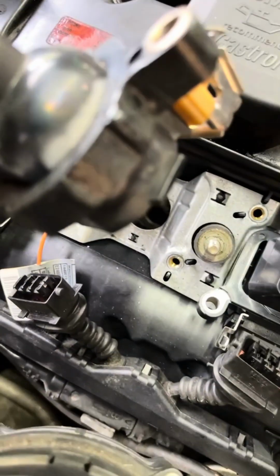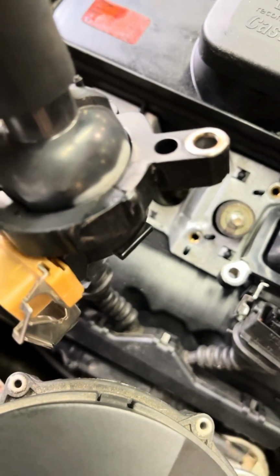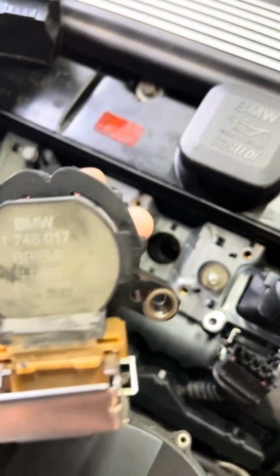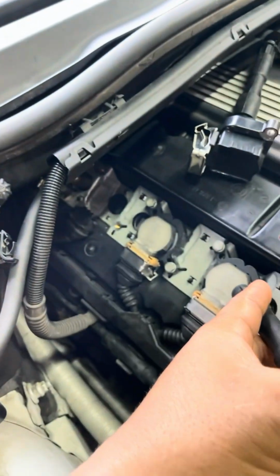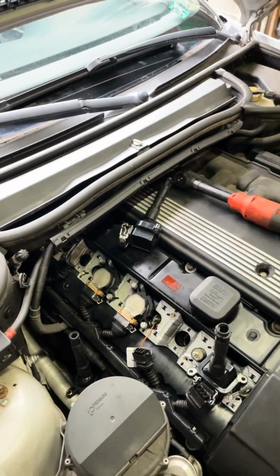And while he was here, look at the marks there. That's arcing. That little white right there tells me that this coil was bad. Why didn't they replace it while they were here? We're gonna do 6 coils, gonna take care of this issue here. Very simple. Thanks for watching.